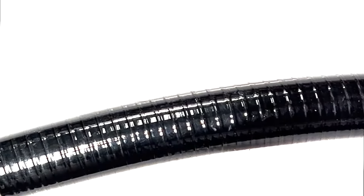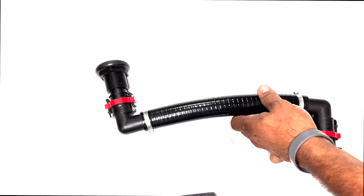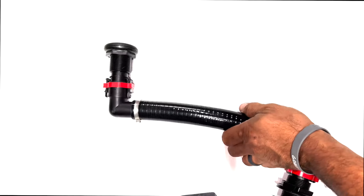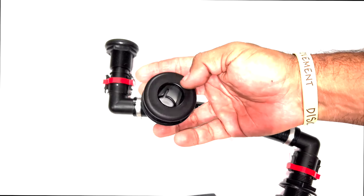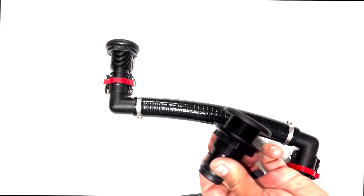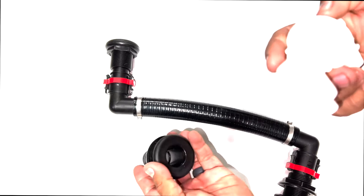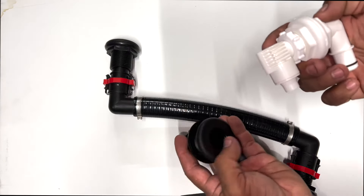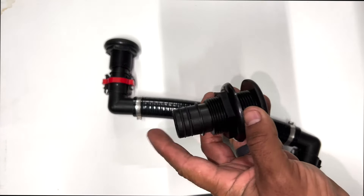First off, all you really need is a fill nozzle and an overflow fitting in some way to drain it. This setup is common for redirecting the overflow of water from the live well through the subfloor and out below the waterline in the back of the boat. You can also use just a straight 1-1/8 inch overflow fitting and run it out the side of your boat if your live well is up front and close to the side. A lot of deep-V aluminum hulls with northern-style setups for pike and walleye are made like this.